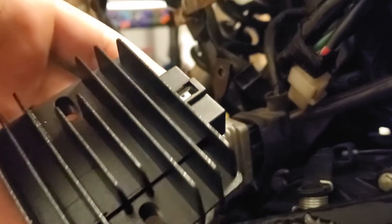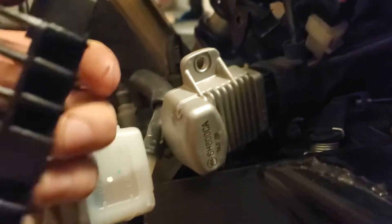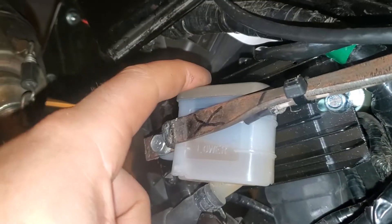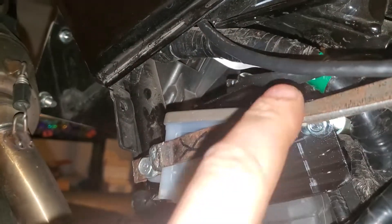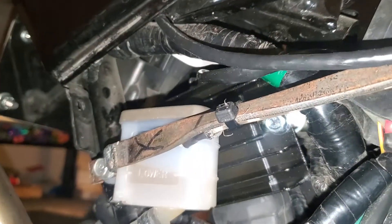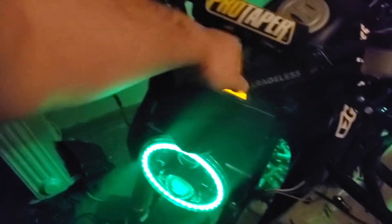Got this rectifier and we're going to swap it out with this one from Steady Garage so the headlight will work. It's in there — you kind of have to bend the bracket so it'll clear this. I'm sure if I didn't have the underglow stuff it probably wouldn't have been an issue, but yeah, had to do that.